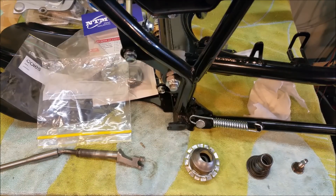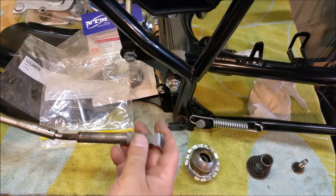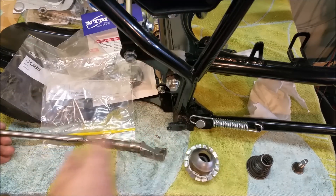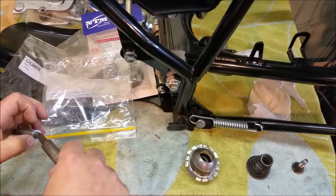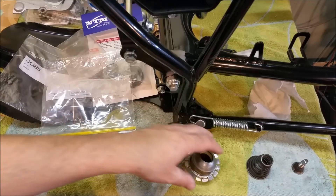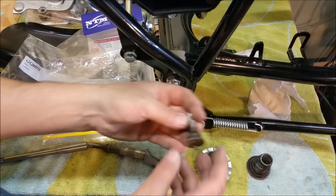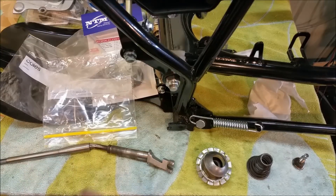To be quite honest I'm having a few memory issues with this. I made this shifter some time ago — months and months ago, I think back in May — and I broke a drill bit in here and I managed to get that out. I bought half a dozen roll pins and I can't remember what I've done with the rest of them. It's sturdy — that's a really tight feel. It's not tight in a bad way: you can take that roll pin out and it'll come apart, which I wanted to do for fitting this new nut. Here's the old one which has got the nylon thread that always flogs out, and it had a big jubilee clamp holding it to the top of the gearbox.